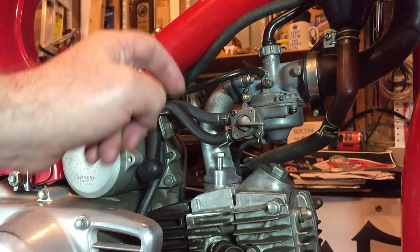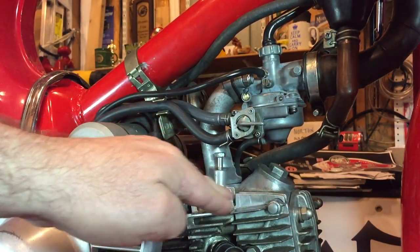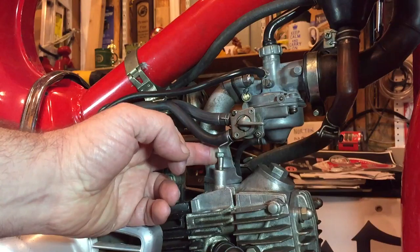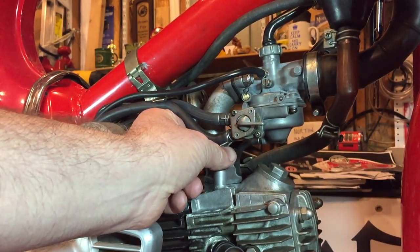So I'll tighten these back up again, remove the carburetor from this manifold, then remove the manifold, clean this whole surface — obviously not getting anything into the head — and then I'll apply some gasket cement, or I'll just see if I can maybe even make a gasket, before reseating these bolts and then trying again.